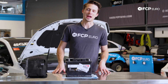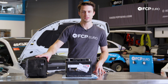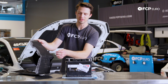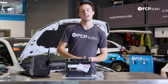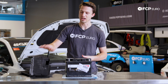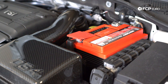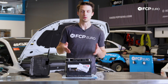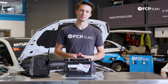So that wraps up our battery install on our Mark 7 project car. I hope you found that helpful. We're actually going to keep this cover off for a couple of reasons: first, because you can see the battery acid that leaked out of the old battery ate up the whole bottom of it. The other reason is because we installed a beautiful AGM battery with a really nice red top — it looks pretty. And the last reason is because AGM in general is more resistant to heat and vibration, so we're not so concerned about having this cover on. That said, if you're putting a regular lead acid battery back in your car, we would highly recommend using this cover again. I hope you found this helpful — if you like this video, please hit the thumbs up button, subscribe to our channel, and if you have any questions, please leave them in the comments below. Thanks for watching.